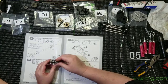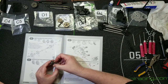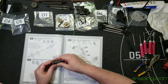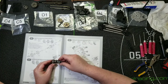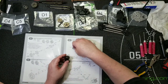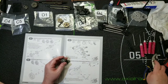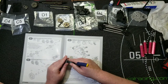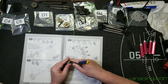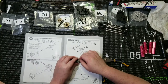And see this is one gear and this is another gear. So when that shifter slides over, it engages this gear, see? And that makes that gear drive. Or if it goes over that way, it drives this gear. And this one just pre-spins. So that's how it shifts gears. It's either going to engage this gear or that gear. So now we got the fun part, putting the snap ring on. And I usually just open up my pliers. Actually gonna have to put some force on this one.